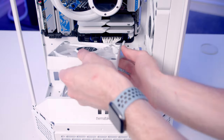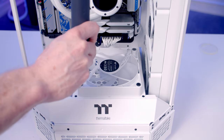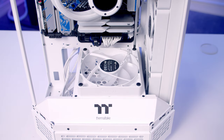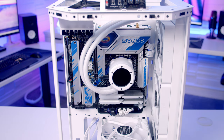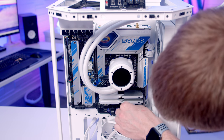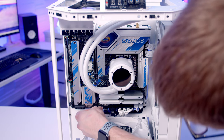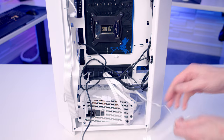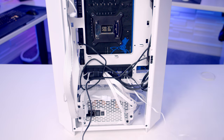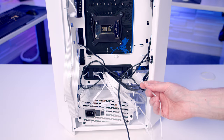Next we set up a 140mm fan at the bottom set to intake. Pass all cables coming from the fan through to the back, then use the long radiator screws from the case to secure the fan. With our triple pack of fans we get a double ARGB and double PWM splitter cable with long connectors. Bring the ARGB cable through and plug into the ARGB header at the bottom of the motherboard. Plug the long PWM cable into the system fan header. At the back, plug the PWM cable from the fan into the PWM double splitter cable — that leaves a longer PWM connector for another group of fans. Do the same with the ARGB cable, leaving a long ARGB cable to plug into another group of fans.